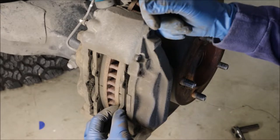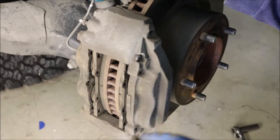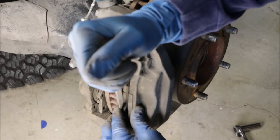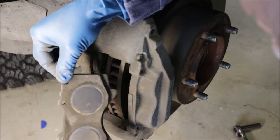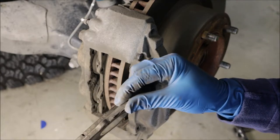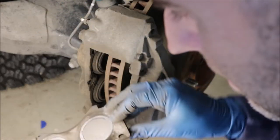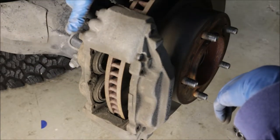I'm going to loosen the cap on my master cylinder just so the fluid has a little extra room to go — but make sure you don't open it too much so it doesn't overflow. Just enough to get the pads loose; you can always compress them a little further if you need more clearance for the new pads and rotors. You can see there is a pretty good amount of meat left on these pads still — maybe with those shims they might be OEM. It's unfortunate I can't find my impact gun, so I'm going to have to break these two big caliper bolts with a breaker bar myself — 17mm.